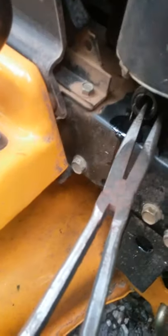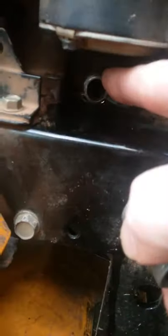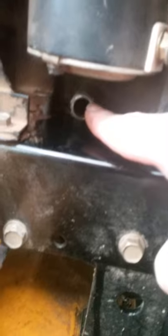I'm going to take these pliers and unscrew the fitting down here. There's the pipe — what we took this piece off, this nipple or coupler. The piece that's on there is on there pretty good so I'm going to leave it and put some Teflon tape on this piece, put it back on, and put the plug back in. Looking at the back — it looks nice and dry back there, no leak.